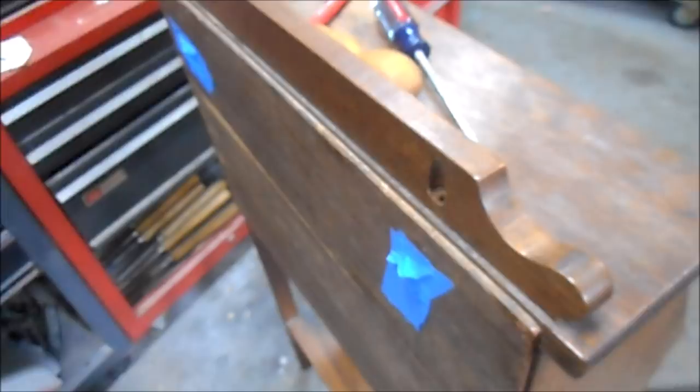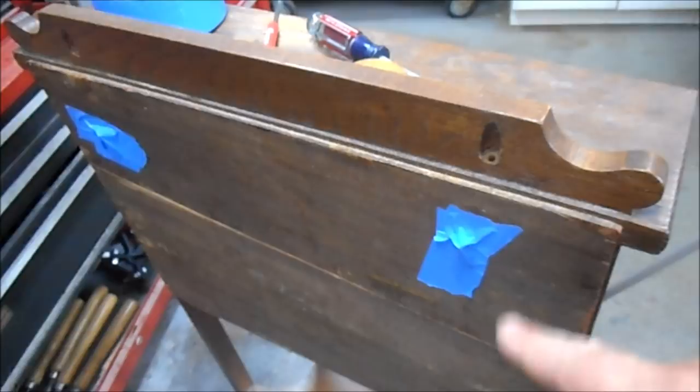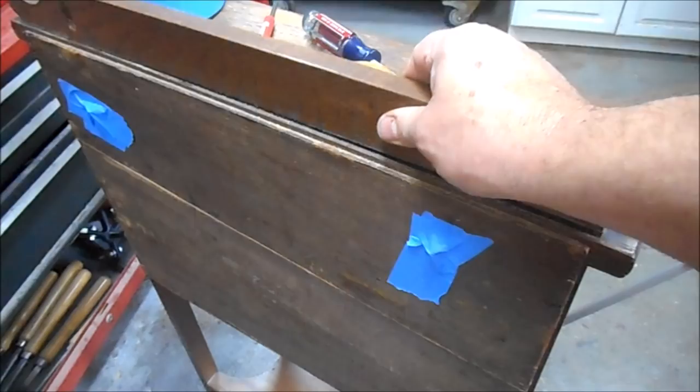Both screws came out the same way. Dug out the grooves, heated them up, backed them out with a screwdriver carefully. I've attached them to the back of the piece so we don't mislay them. And here's the upper trim piece.